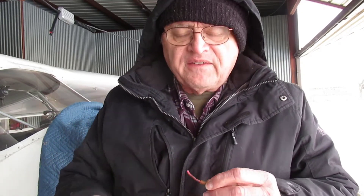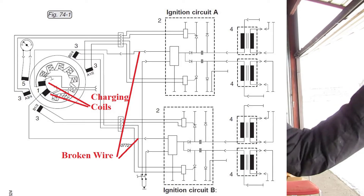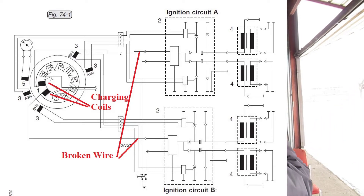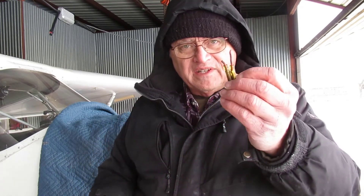Now, this is the early style of ignition module — they've changed some of this since then — but if you're having weird magneto problems, check these wires. With this wire broken, there's no power getting from that charging coil under the flywheel up to the ignition module, and there's no ignition. At higher RPMs, apparently there's enough voltage to jump the gap and power it, at least sometimes. That's something that's probably not unique to me, given that there's a total of three breaks in these two wires. So if you're having magneto problems, it's something to look at. I hope you found that helpful. Thanks for watching and I'll catch you on the flip side.